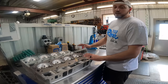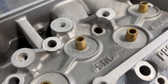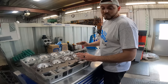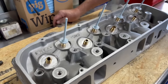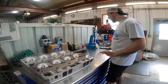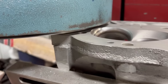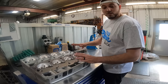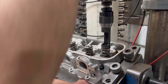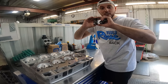In this video we're going to cover the entire process of rebuilding this set of Dart Pro 1 CNC big block Chevy cylinder heads. We're going through and replacing all the valve guides using thermal expansion and liquid nitrogen, then moving into our performance valve job cutting the valve seats, getting ready for new valves, resurfacing the heads, and finally building the heads — which includes testing these monster valve springs that I can barely even make budge.